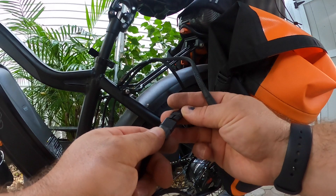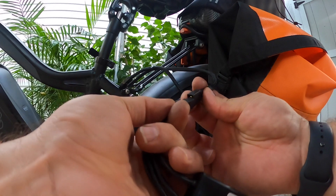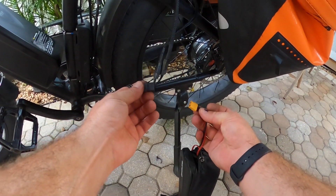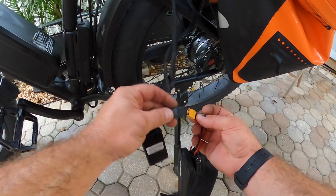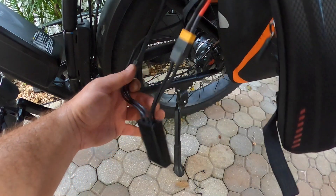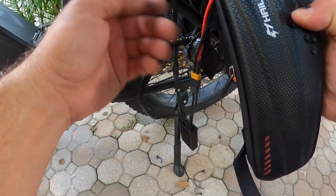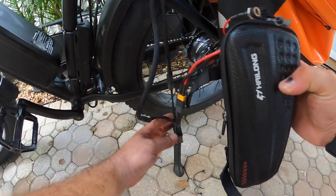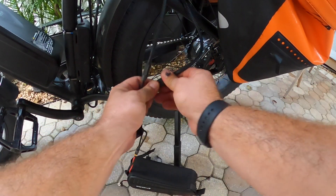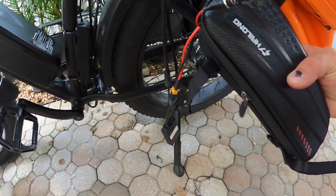This is the battery input, and then we have controller out. We're going to take the secondary battery and hook it up into the second input on the discharge balancer. We've already tested the factory, so I'm going to disconnect the factory battery — which I know to be this one — hold this in connection, and then turn on the bike.